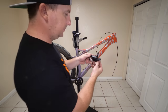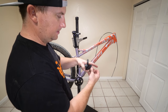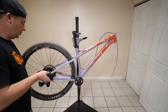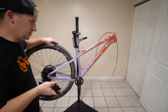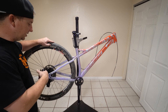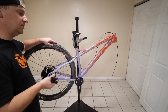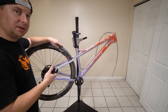Here we have the shifter. We've got a nice little rubberized thumb pad there. This only goes forward like SRAM. I wish I had a little hinge on this, but that's not the end of the world. If this works and we can get it reliable and dialed in, I think it's like $160, maybe $170 for the cassette, shifter, and derailleur. It's crazy cheap. And if it works well, this is the perfect place to save money on your bike so you can get something like a really great fork or a great wheelset. Most people can't tell the difference between an NX and an X01 derailleur and cassette apart from weight. So that's a great place to save money on a big build.